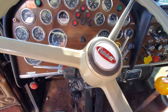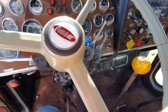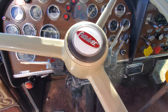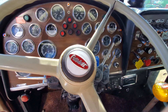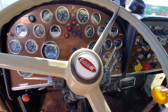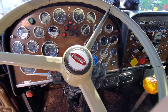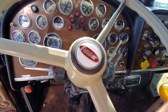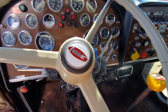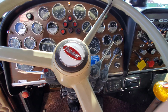When I bought it the jakes weren't working — I got those fixed and they run quite well now. I also replaced both thermostats in the engines. Before, it would run up to 200 degrees and even with the engine fan on I could hardly get it to come down. Now it sits at about 170 all day long. This truck is turned up so I wanted to make sure it stayed cool. When I tested the old thermostats — which were rated 180 degrees — they didn't open until 195, so that kind of explained the issues. Even idling in the yard it would just climb like crazy.